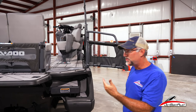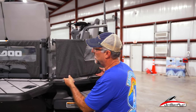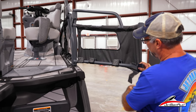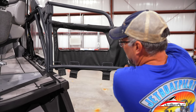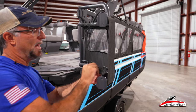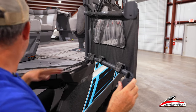Something that we've noticed on a few Switch models that we've installed is these pieces of tubular railing here are not always exactly square with one another — it's not a precision part. So to make this work, sometimes you're going to have to apply a force to basically move this rod more in alignment with the upper rod. We had to do it with ours. What I've done is taken the vinyl here, undone the straps so it's independent, and just applied steady force until I feel like I've got a good bend. I don't want to move it a lot, but we're just trying to force this in a little bit so that these are better in alignment with each other. Then put the straps back on — you may have to do this a couple of times. This will make it align easier if you're seeing some resistance going into that bottom bracket.